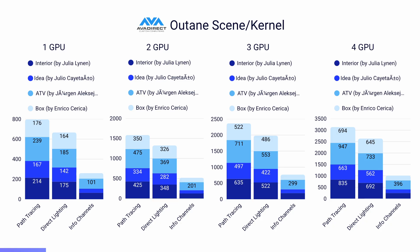Lastly, we have Octane. There's a substantial amount of numbers displayed for Octane's benchmark, so feel free to pause the screen and review the information. In the end, it verifies what we saw in the first two benchmarks: every application that takes advantage of multiple GPUs gives you an additional 100% increase in performance with each GPU added. Largely, this is due to the WRX90 platform providing full bandwidth for each PCIe 16x slot — the CPU has all the available PCI Express lanes to support the cards running in tandem.